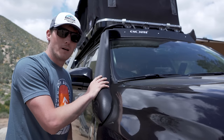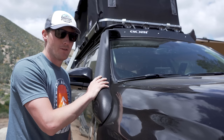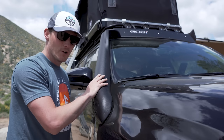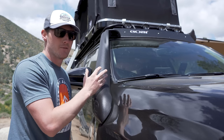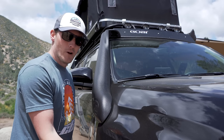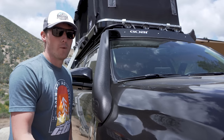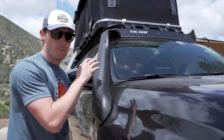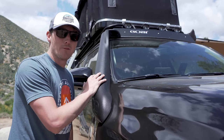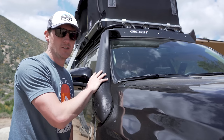I've put maybe 2,000 miles on it since the install. The air is cleaner — even after a couple runs in the desert the filter has been great. A lot of people with snorkels assume water crossings, and that's an obvious benefit, but the real benefit is cleaner air. Otherwise you're pulling air from your wheel well which is always kicking up dust. This has proven over my last couple builds that it keeps the air box cleaner. I try to stay away from water whenever possible, but this is good insurance if I need it.